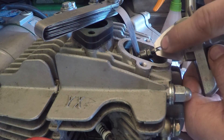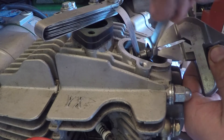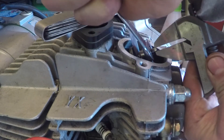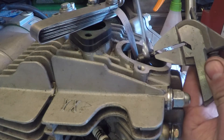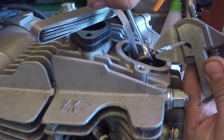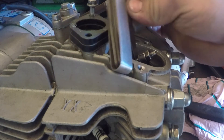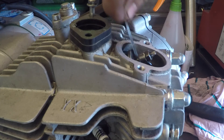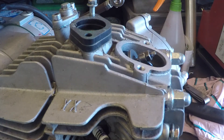What I need to do now is stop this little screw from moving as I tighten up the lock nut. So I hold it with this and pinch the lock nut up tight, because you don't want that bouncing around inside the engine if it comes loose. Take the gauge away - the gauge still works, hasn't tightened up any. Spot on the money, we'll just put the cap on it - hundred percent.